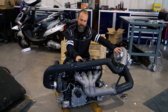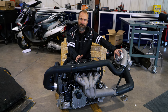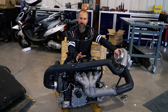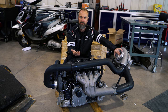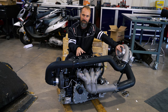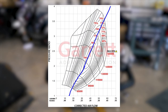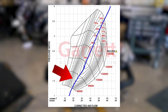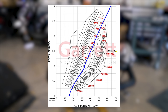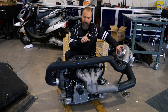That's where you need engine modifications like camshaft, valves, cylinder head, and fuel — or even nitrous — to increase the base horsepower from 180 to around 200+ horsepower, moving the operating point back toward the best efficiency zone of this turbo. Once we understand that limitation, if you're looking for something in the 600 horsepower range, you can use a smaller turbo — maybe a 62, 64, or 68 mm — which pairs much better with these engines. I'll share the efficiency graph for a 62 mm turbo to show a much better efficiency zone, far from both the surge and choke areas.